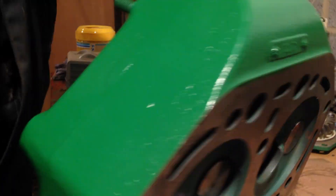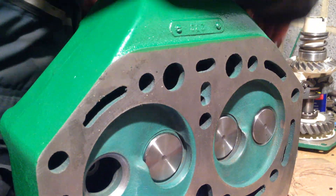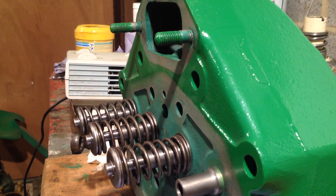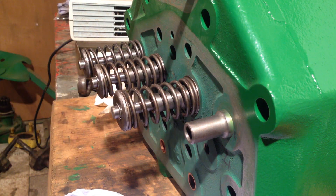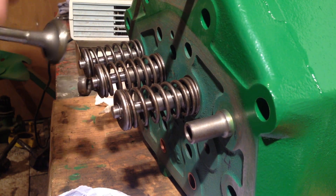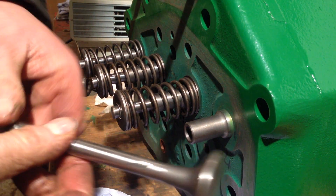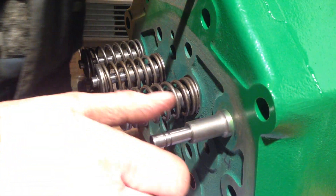So we'll lift it back over and you can see that - there it is, nicely in there, all sorted. So we'll do the exhaust valve now. As you can see the head, I put a top coat of paint on the head - this area here is hidden in amongst the chassis so you can't get to it. So again, a little bit of grinding compound - it's the finest one I have. It's just a matter of polishing, just taking the rust off. As I say, the seats and the valve face just got a bit rusty.